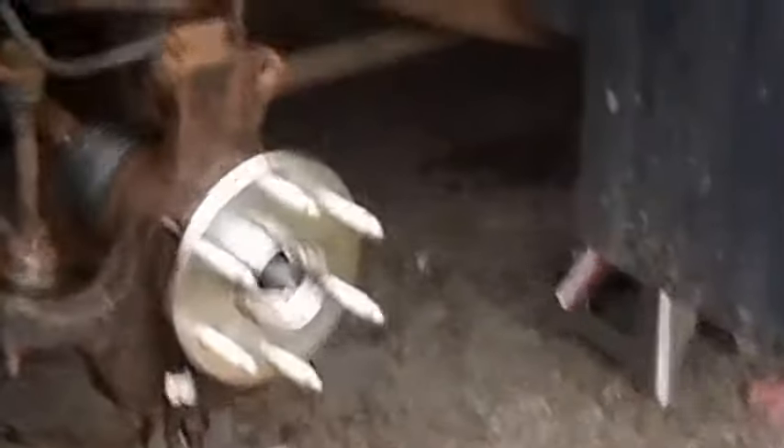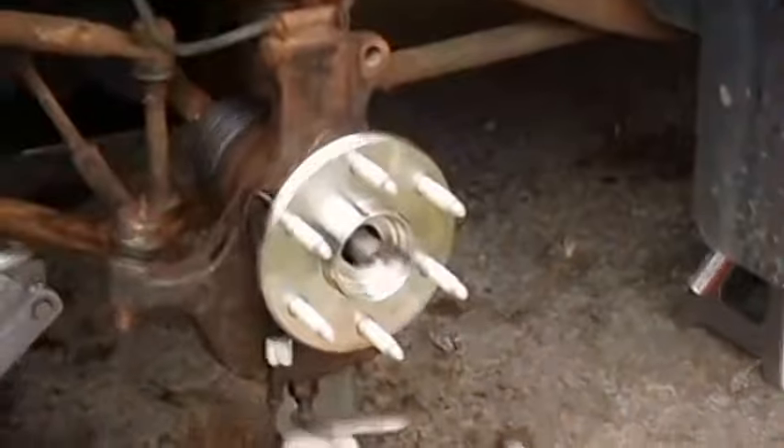To make things easier as you're tightening the bolts for the hub assembly, cut the wheel all the way to the right or left to get to them. It helps to access it and get the CV out of the way. That wobble extension lets me get around the CV axle assembly. I'm going to go back and forth and snug these all a little bit, then dog them down after.